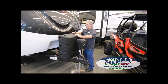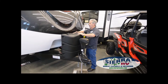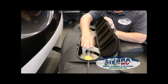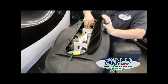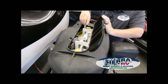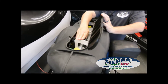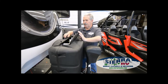We always fill the propane tanks so you've got two full tanks as you leave here. You have a controller right here that goes from side to side so you can run on one tank. When that one runs out, flip it over and come on the other one. If you want it to flip over automatically, you can turn both on and when one runs out, the other will start. Most people like to know when one's out so they know they need to fill it before they go next time.